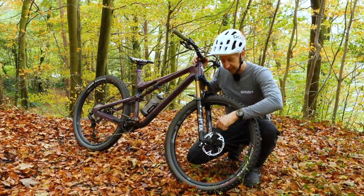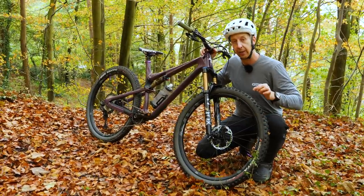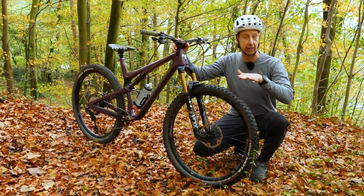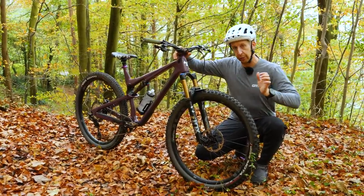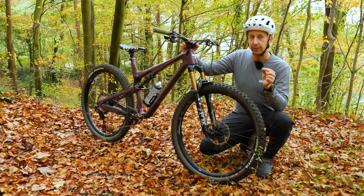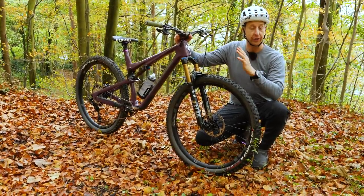Have a good look. Take your disc rotor off, do this off the bike, give it a thorough clean around there. If it's not that, then it could be the spokes themselves creaking within the nipples. When wheels are built, as the nipples are turned onto the spokes, the spokes can turn slightly as well. It's a process called tensioning or de-stressing the wheel — you push on the rim and that hopefully lets those spokes unravel. The key to preventing this in the first place is by having literally one drop of lube on each nipple all the way around when you're tightening them up, so the spokes don't bind.